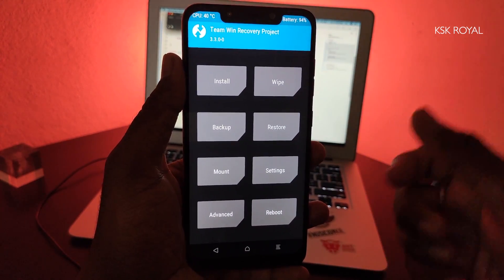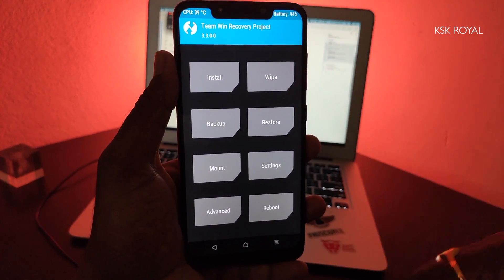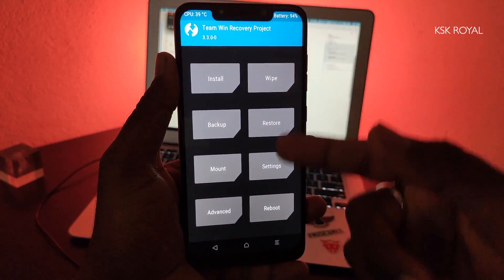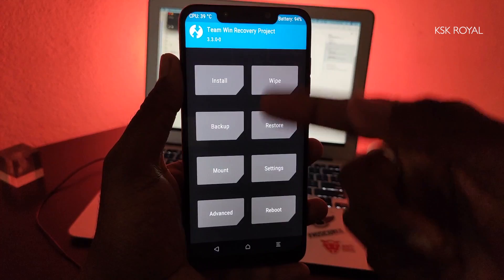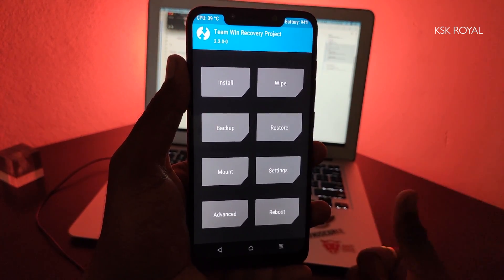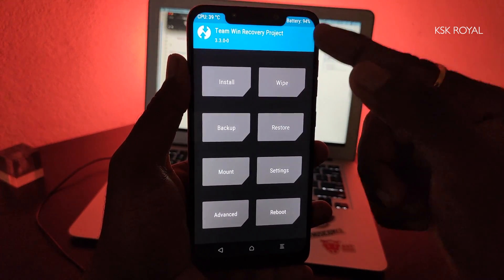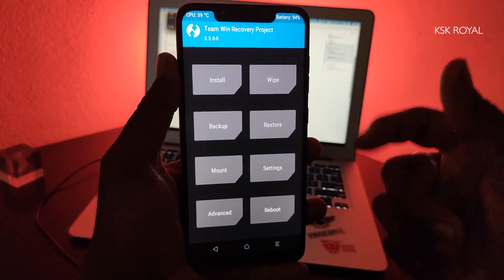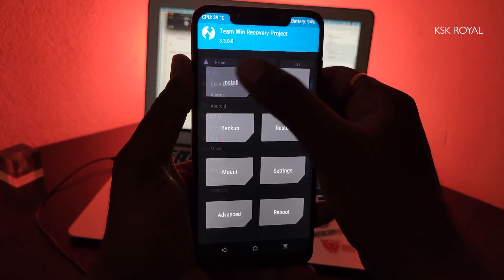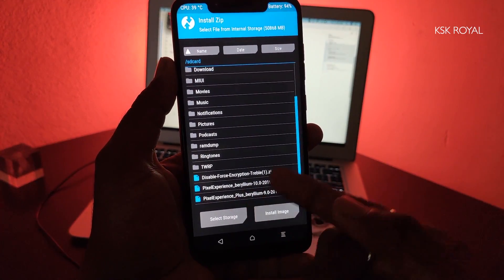You can see there is no encryption screen appearing here because we removed the lock screen passwords, fingerprints, and everything. If you don't remove your lock screen and fingerprints, an encryption screen will appear and TWRP won't be able to read the data on your phone. Make sure you have the Android 10 ROM loaded onto the internal storage.